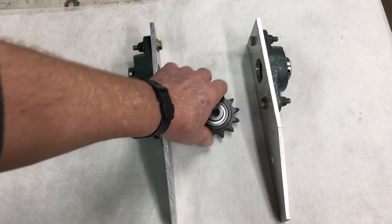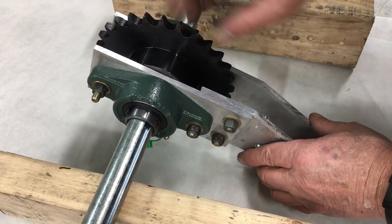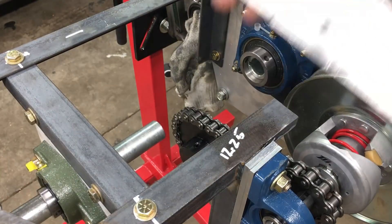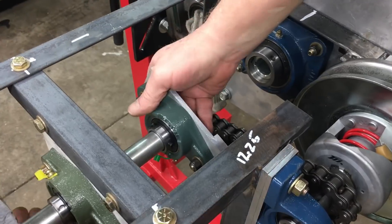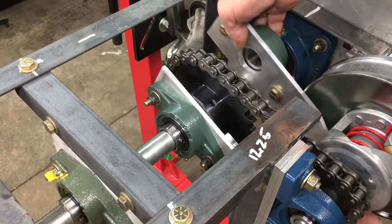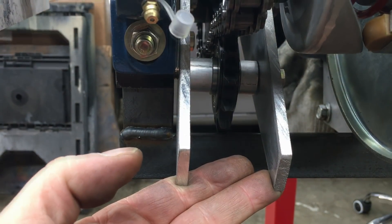Off-camera I fabricated a prototype chain slack adjustment system. This is kind of the basic shape of what I need, but it's definitely not the final design. The idea behind this system is to use the input shaft as a pivot point, and the rest gets very complicated. To give you a better idea of what's going on, let me go ahead and install this thing on the engine cradle. Now I'm taking a shortcut and installing the parts whole, but in the event of a sprocket change, this gizmo comes apart into smaller pieces and can be removed with the input shaft in place. On the older system, the engine and transmission adapter had to be removed from the car in order to change the larger sprocket. Now the idler sprocket is on the slack side of the chain and can pivot upward to tighten the chain.